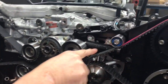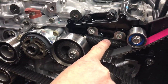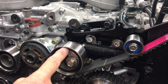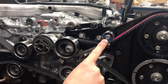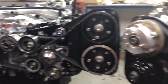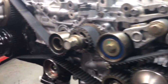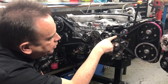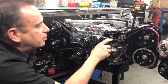This part here is the early model tensioner on the early model Subaru EJ series engines — it's a piston design tensioner. Inside there is a mechanical design to exert leverage on this pulley to tension the belt and keep the whole assembly tight. In the early model design Subarus, they never had this idler, because this particular idler only came in the later redesigned engine.